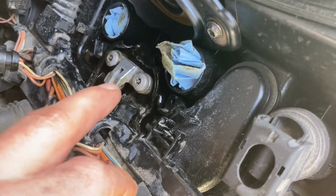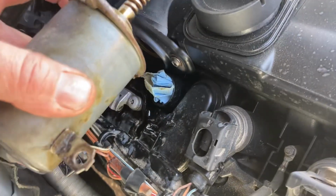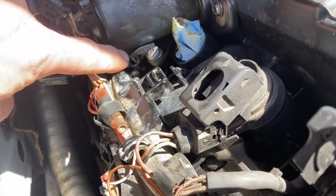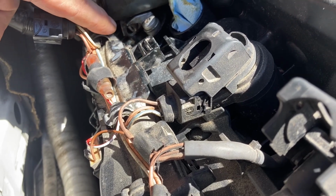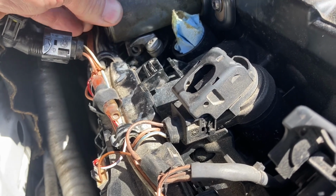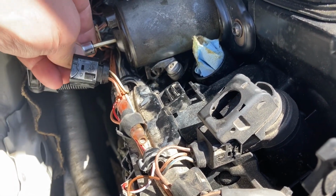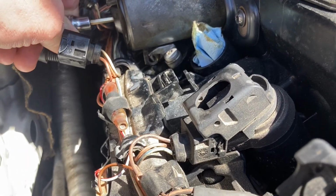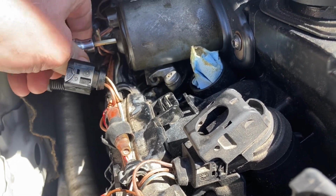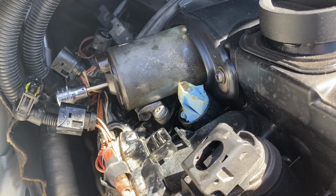So just as I'm going to put the motor back on here, this slot here lines up with the tab on the motor. So this tab right here. Okay, so I set the motor in place, and if you look down here, you can see that tab I was talking about that lines up with the slotted part. It's not lining up, and it's almost all the way in. That's when we're going to get our 4mm Allen key. The socket works fantastic. So you can put it in and just leave it there and twist it with your fingers. But I'll hold it, and you can see when I rotate it, it starts to line up. And there we go. So I'll just do it properly with two hands and tighten everything up, and then we'll get on.